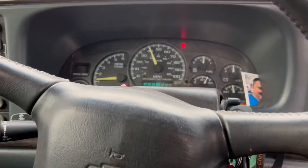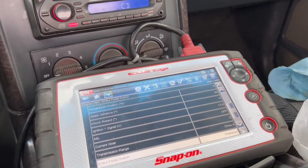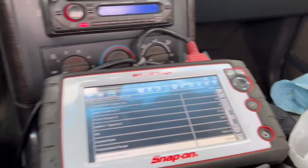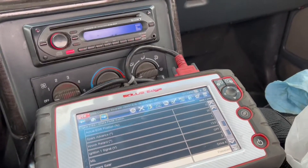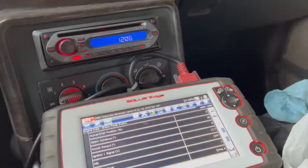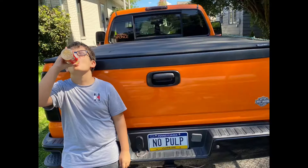A little loud, but we'll deal with that later - put some tailpipes on her. We're up and running. It's got 390-something gears in there with 3.73s in the truck, so we'll figure that out. If you have any problems let me know - between everybody on YouTube you can figure out anything. By googling '4L80 stuck in second gear,' the internet told me the computer was reading no power, so basically the plug from Amazon wasn't doing its job. We're working now - like and subscribe for more handy helpful hints.